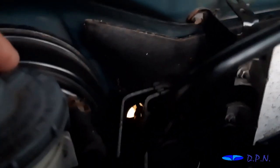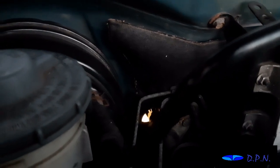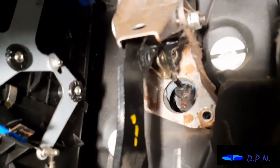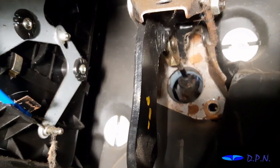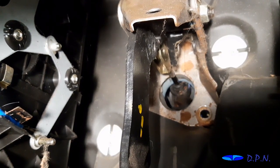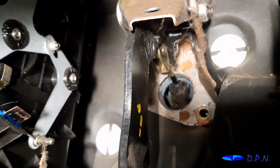Right, so we've got those two bolts removed, and we've also got the pin out that was holding them forks to the pedal. And what we're doing now is slowly manoeuvring it out through there, and hopefully you can see the hole in the firewall where it's coming out, and you can see the bolt there, and also the bolt down there. So we've now got to get it completely out, and then we'll show it to you a little bit better. Right, so it was a bit awkward for me to get the camera in here and show you what was happening, but hopefully you can see now we've got that bolt out there, and also the bolt that's up at an angle, and we've also got the pin out of the fork, so it's disconnected from the pedal. And if we now go round to the engine side, I'll show you as it's now hanging out, as we've now pulled it through with those bolts that are attached to it.